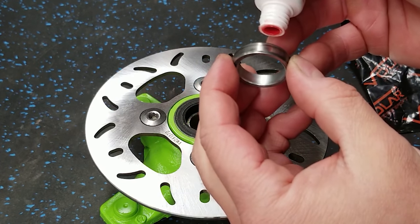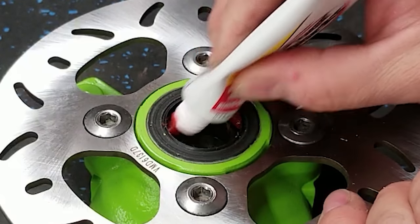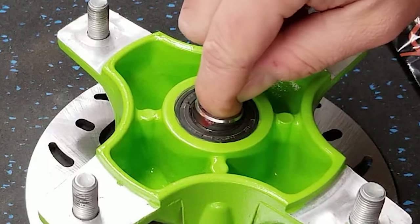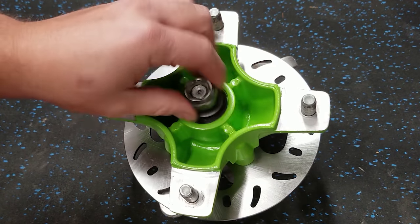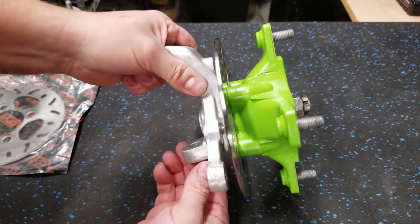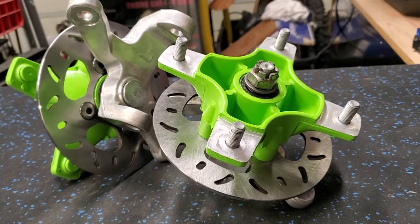We got our bushings - I did clean these off and I'm just flipping them around, putting a little bit of grease on them. These bearings actually feel like they're in good shape so I think we'll be good. We'll go ahead and place this on our spindle, see what it looks like, put a washer and our nut in place - we won't tighten this until it's on the quad. Man, that looks killer. So much better than it did before. Hell yeah - I'm really happy with that color. Let me know in the comments what you guys think.